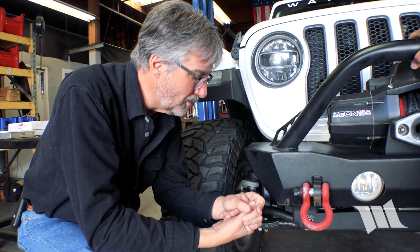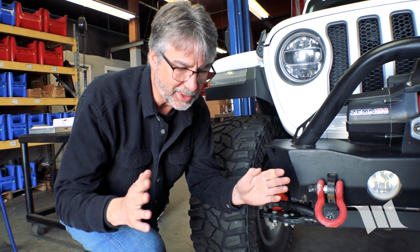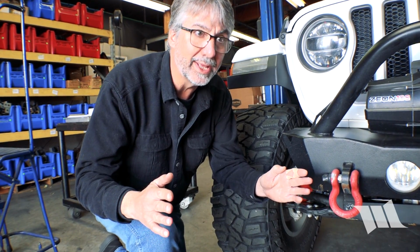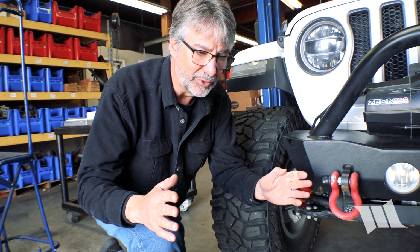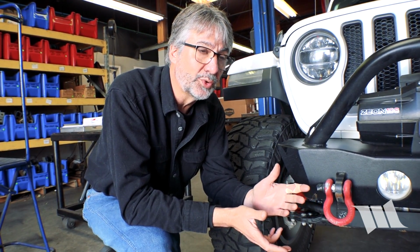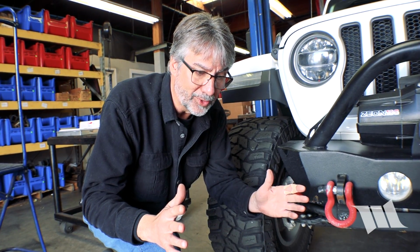Okay. So what can happen is when you set the toe on your car, you're trying to make sure that the tires are pointed not dead straight ahead. They need to be toed in just a little bit. And so if you have looseness, like say more than 5 or 10 thousandths or 15 thousandths, you start getting up to 20, 30 thousandths, that is going to start to allow the toe, you could set it up, but it's not really where you think it is. As soon as the vehicle starts to move forward, the toe changes.